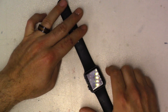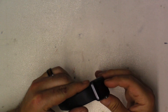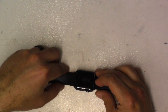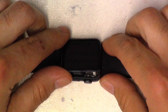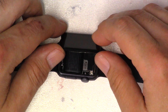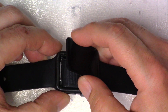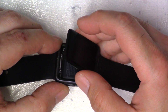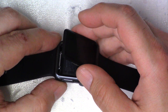Alright, so here we are. This is the scenario — the battery has pushed out and you can see there's a lip there, very frustrating. So we're going to take a look at the kit. When you pull the face off, the ribbon cable in there you want to be careful of. There is tape that holds this down, and then there's the force touch strip. Mine still works — it just came up with the battery plate.